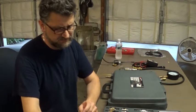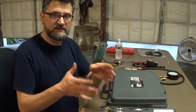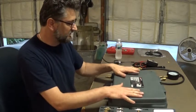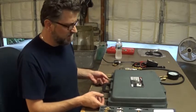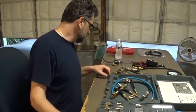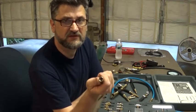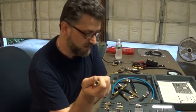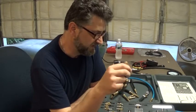With many cars these days we don't have a Schrader valve, so I needed a kit that I can actually tap into the fuel rail and fuel line to get my pressure reading. I decided to purchase this PT Performance Tool Master Fuel Injection Test Kit. Honestly I wasn't really happy with it. It has a lot of adapters, but one of the main adapters that you tap into the Schrader valve — after the third usage it lost its rubber gasket and started to leak. I just don't trust it anymore, so I decided to modify this kit to my needs.